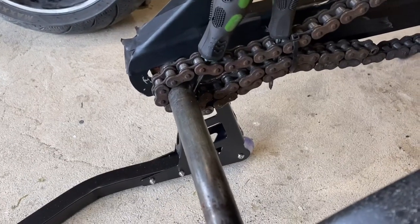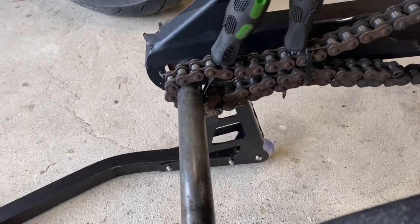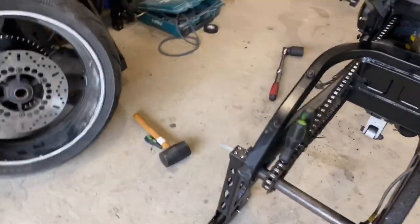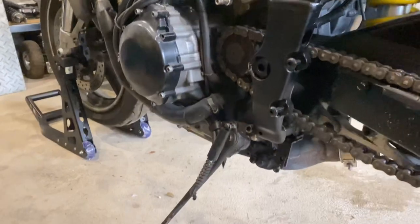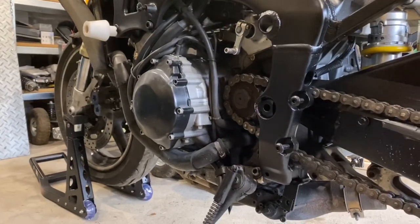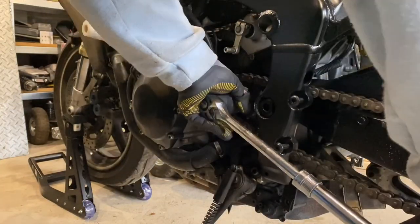This is what you need to do to get your front cog off: wrap your chain around your axle and pop a screwdriver down through the top into the bottom. I put two through just to make sure so it doesn't slip. We're going to get the socket on it and get it off — this is going to take a bit of force.